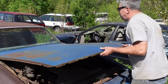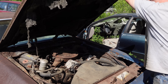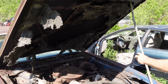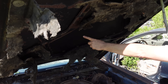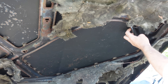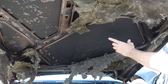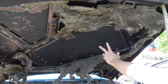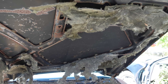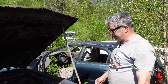Nothing to it. Or is there? Well, we look underneath, and before we get to the engine, something kind of worthy of note is the fact that the bottom side of the hood has this sort of trapezoidal shape right here. This under-frame is the same one that was used on turbo cars because they would have a space, a bump for the turbo. So this same under-frame was used on turbo and standard hoods — GM was commonizing that part to save a few bucks.